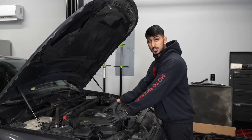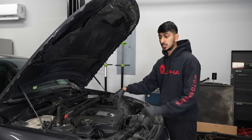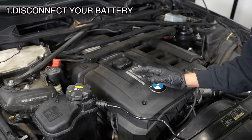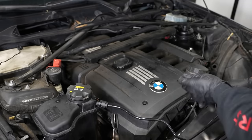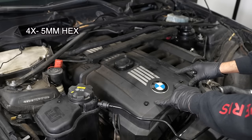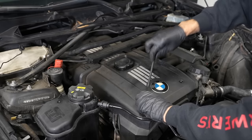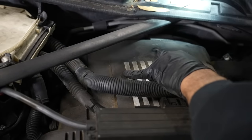We're at the part where we're going to be removing the engine cover, and then installing the tow hook onto the engine so we can put an engine support bar. Before we get started, it's always a good idea to disconnect the battery when doing something this extensive. The engine cover is held in with four five-millimeter hex screws — two in the front and two in the back.